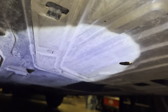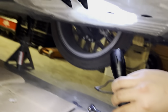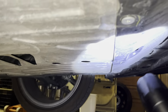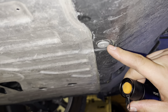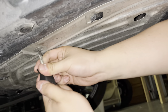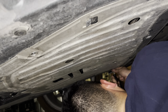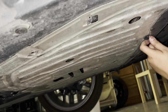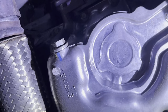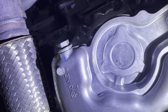So we're under the car — this is what you're going to use the flat head for. This is the skid plate that you're going to take off. There should be one, two, three, four down there and then five flat head spots, and you're actually going to need a Phillips screwdriver also to take this off — there should be two in front. Once you have the skid plate off, you're literally going to see your engine oil right here.